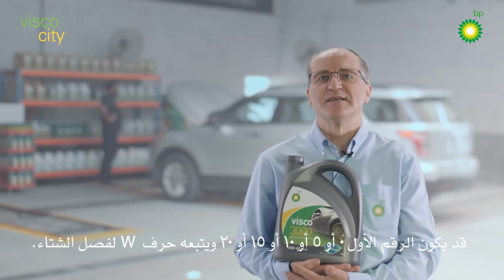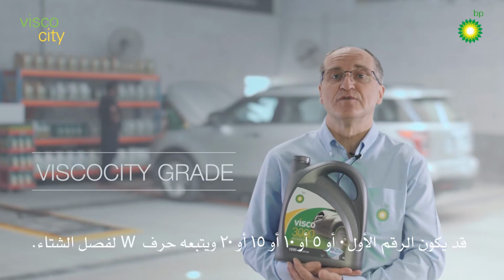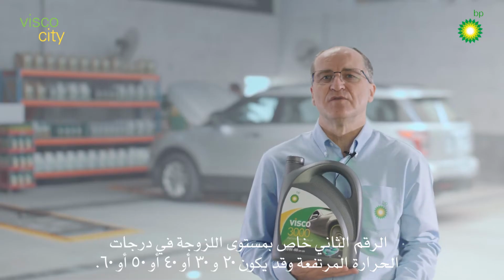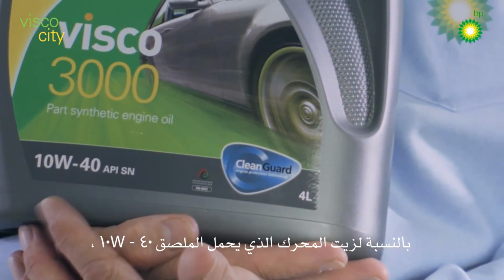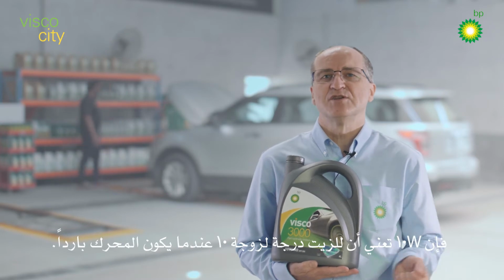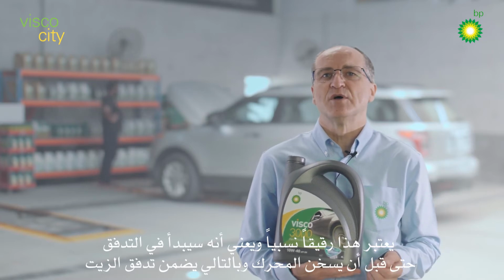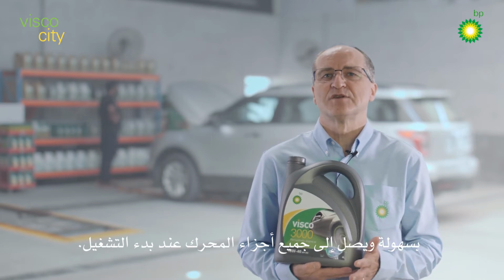The first number may be a 0, 5, 10, 15 or 20 and is followed by a W for winter. The second number is for the viscosity in hot temperatures and it may be a 20, 30, 40 or 50. For this motor oil with the label 10W40, the 10W means that the oil has a viscosity of 10 when the engine is cold. This is considered relatively thin and means it will begin flowing even before the engine heats up, thus ensuring the oil will flow easily and reach all engine parts at startup.